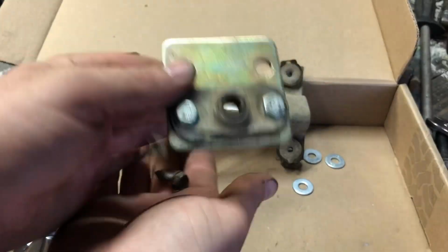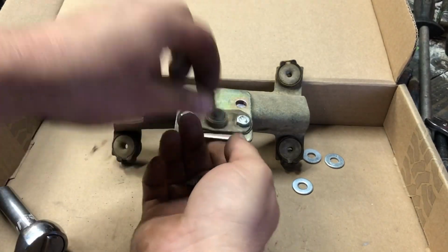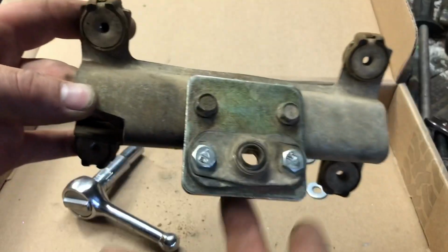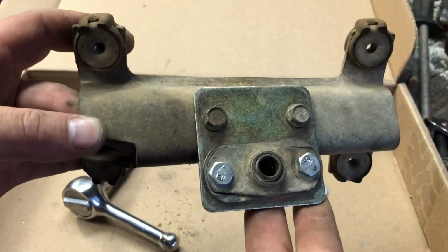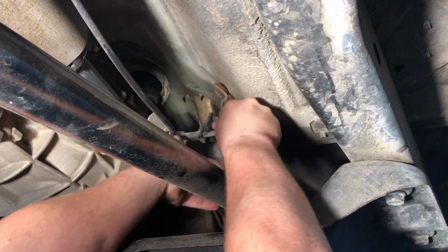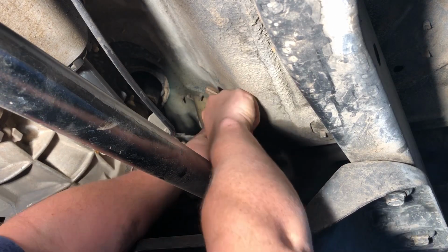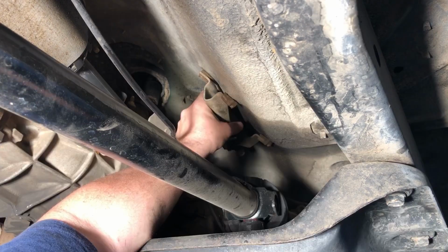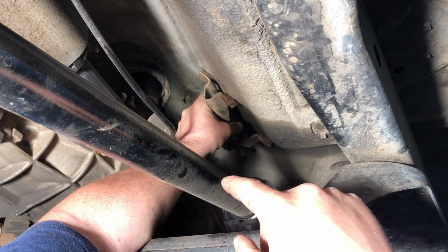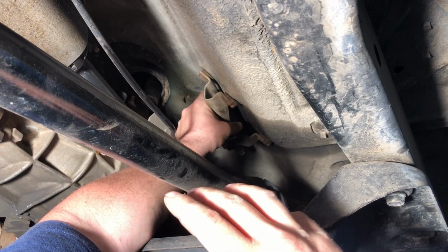We're gonna take the 2 original bolts and bolt the plate back onto the larger mounting bracket. So we're gonna take this back to the Jeep and install it the same way as we removed it. Okay, so we're just gonna get the bracket up in there, and we're going to slip the shaft back into the bracket and go ahead and go back inside the cab of the Jeep, and we're gonna go ahead and bolt our original 4 10mm bolts to bolt this bracket in position.